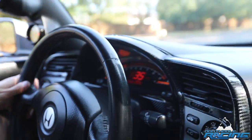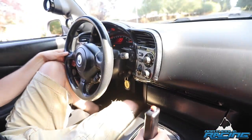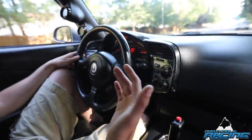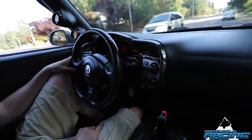It has a fully built Powerglide built by Josh Ross, Ross Performance, right here in Washington — big shout out to Josh. We were going to go TH400 and he actually said no, we're going Powerglide, it's going to be faster. There's a lot of guys out there on TH400s, but they suck a lot of horsepower and they're heavy. So we went with a Powerglide. It was a lot to get used to — the first time out was pretty weird. But as you can see, it just cruises. Super easy to drive; your grandmother could drive this car.